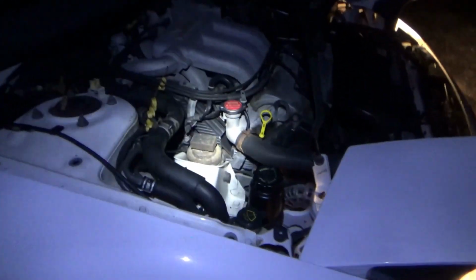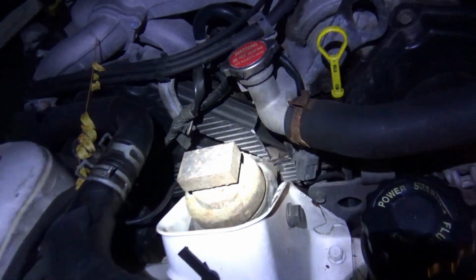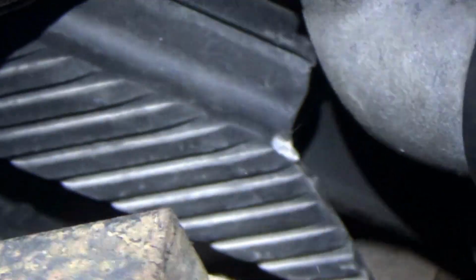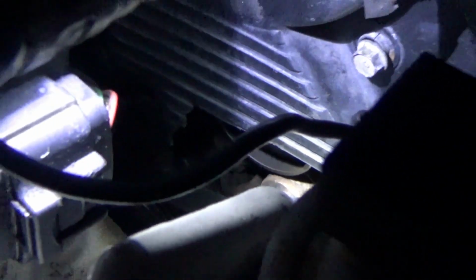There's this concerning knocking going on. Wow. I don't know if I want to drive this thing too far with a knocking timing belt. Yep, you can see the tensioner. Oh, this is cool. They cut out an inspection cover. If you can illuminate that. You see that right there? That tensioner is out of oil and it's going. Oh yeah. Need the timing belt job before going too far with this thing.